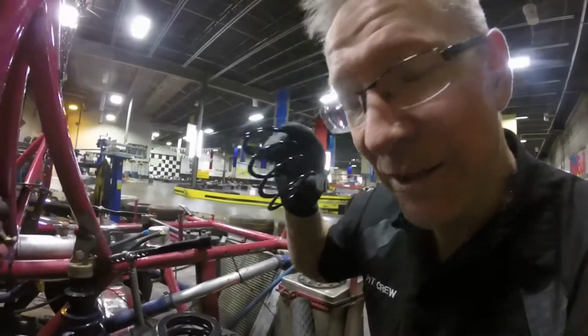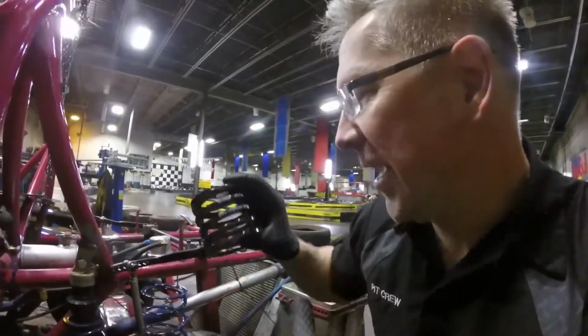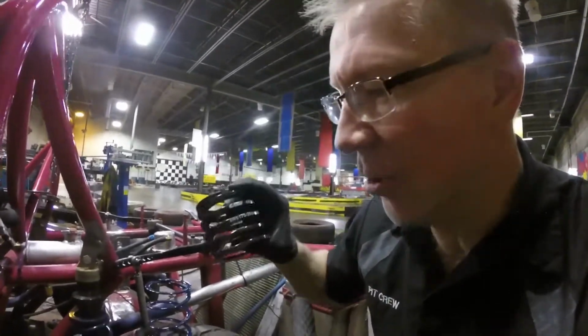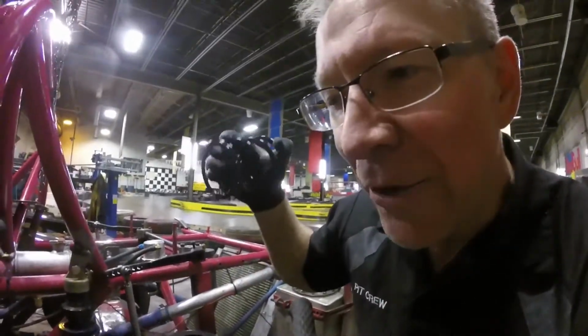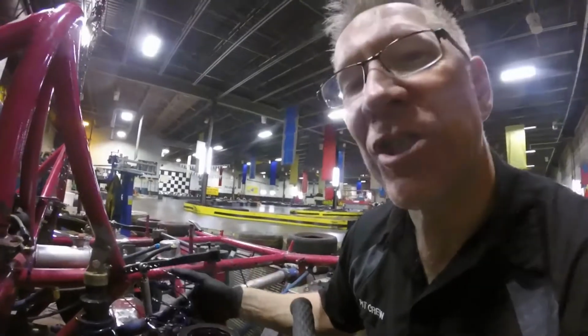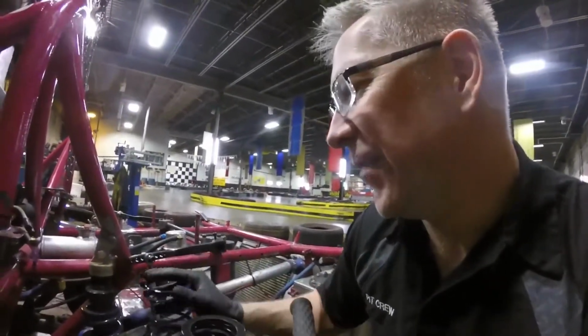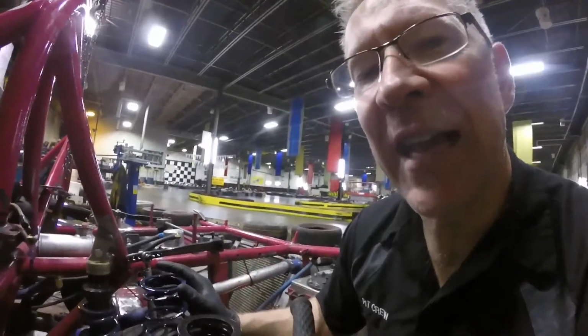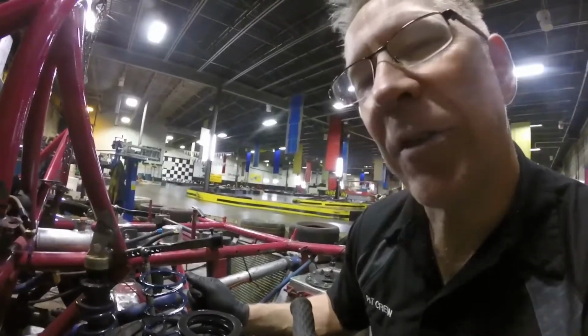I don't know if it's called a tender spring because it's really easy and tender, but anyways, or this helper spring. This is a 200-pound per inch helper spring. But I ordered these before I knew that I needed 400-pound springs in the back of the car. So I'm going to just try them now. We're going to install them, and we're going to see what happens. See how well these will take up that play in the springs there.